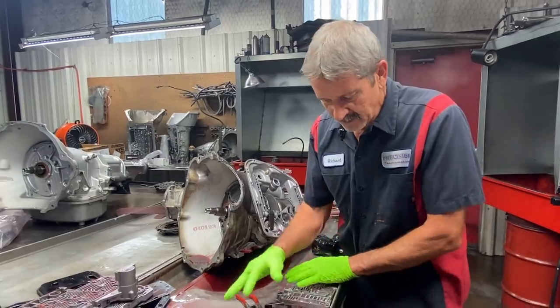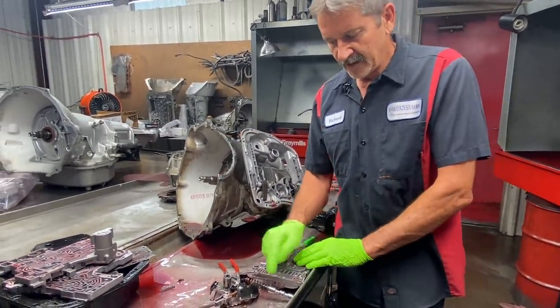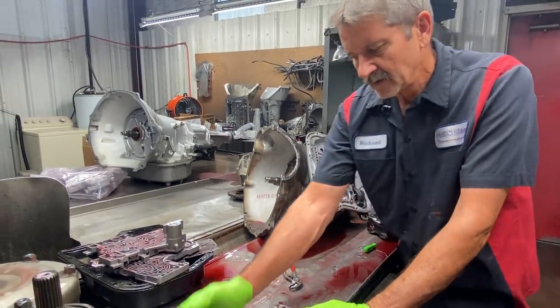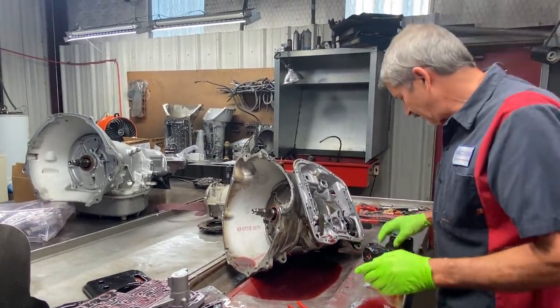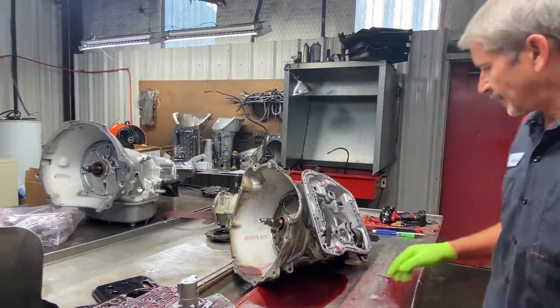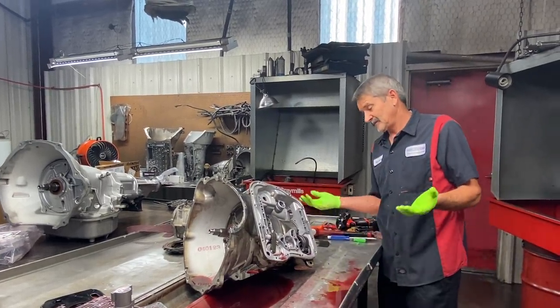So just remember, if you use a SONNAX PR valve and your Transgo kit, you better be careful when you put that together. You need to watch that video and look at it, because I'm telling you guys, you could have a problem. And you're only going to see it mainly when somebody's pulling a big old trailer. They're in Arizona. It's hot, hot out. And, I mean, there you go.